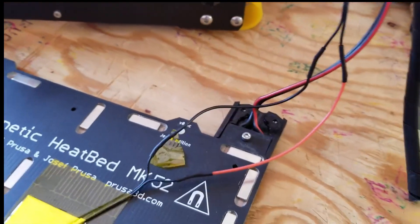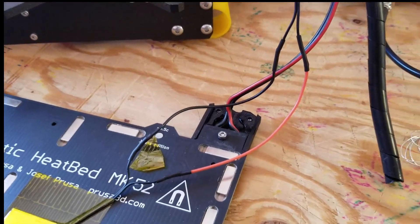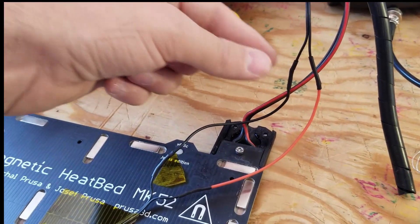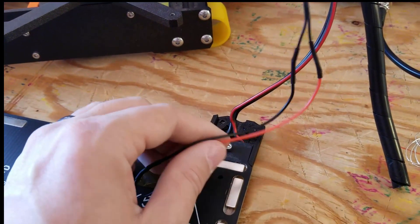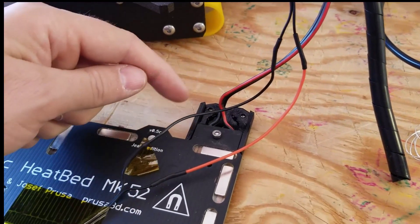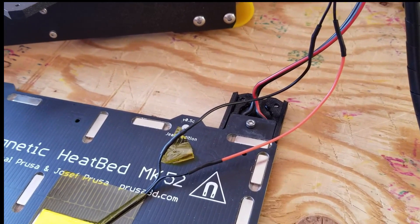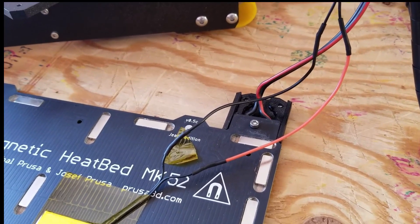There is my wiring job — nothing too complex. I got the heat shrink on all four: heat shrink here, heat shrink here, heat shrink here, heat shrink here. And now in between, this is all that flexible silicone. So this will be down in the area where it was getting pinched before, and hopefully that will solve my problem. Now I just need to get it back together and run it, and hopefully it runs long term.